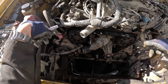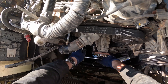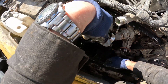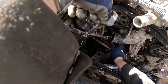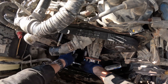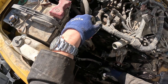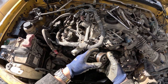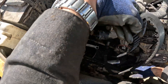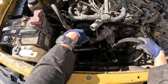We've got to get this old belt off first and foremost. First thing is to pull off the tensioner — it's a 14mm and it's really on there. It seemed very sloppy and didn't appear to have relieved tension when I opened it, but it must have had some tension on it. After that, there's our old belt. You could probably go with a front crankshaft seal while you're in here, which I don't have. But you win some and you lose some.